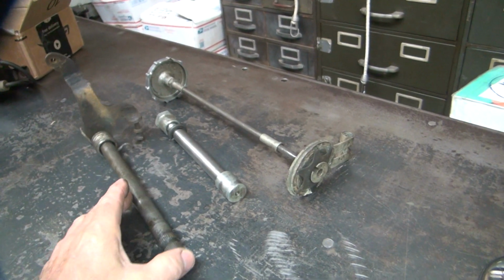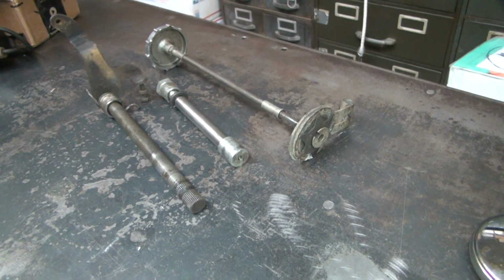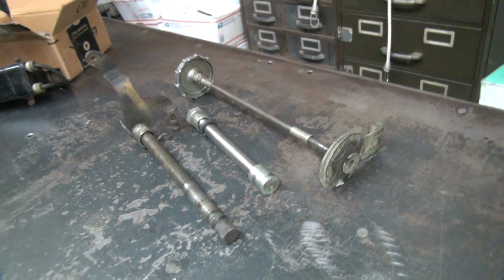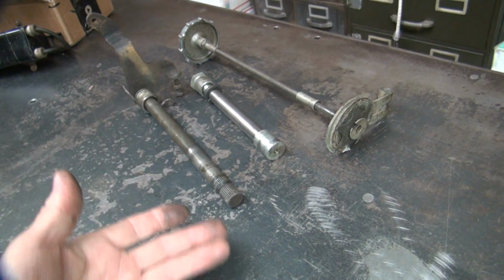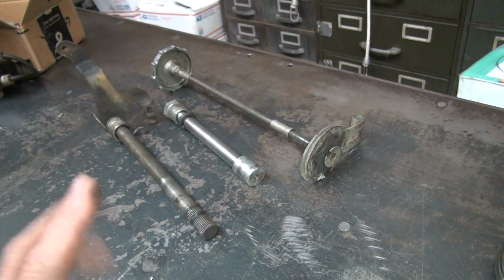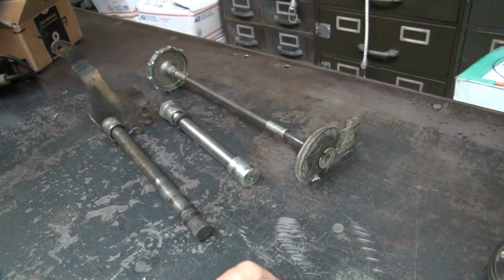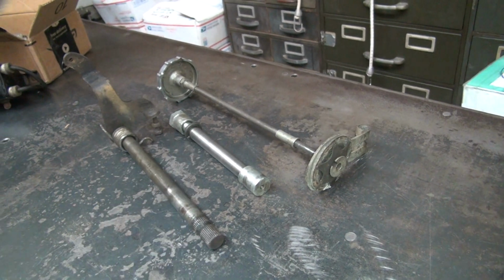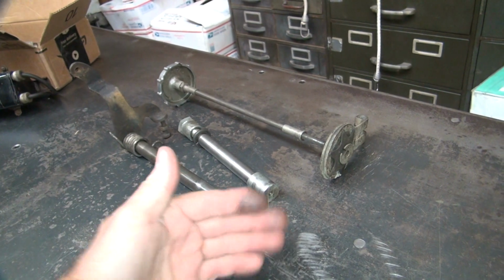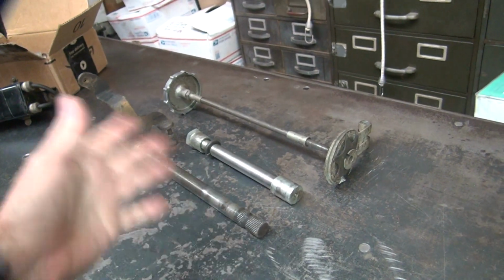It's a place I get these parts off eBay. They strip bikes, so I'd say they stripped down a nice CH bike. Probably something in the 60s. Probably 62 to 69 would be the year range this came off of. Probably 65 to 69 because of the axle being zinc plated like that. That's going to happen more in the mid-60s on up probably. So I'm going to guess this came off a later, mid to late 60s XLCH bike, or XLH through 67 or 66. 66 and back was an early style bike motor. 67 is when electric start came out and all this stuff changed.